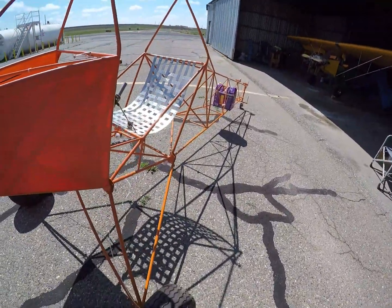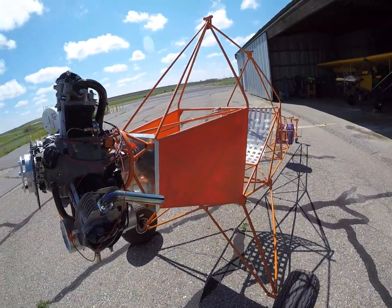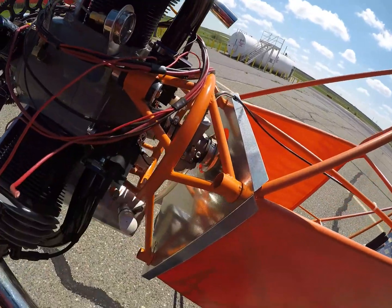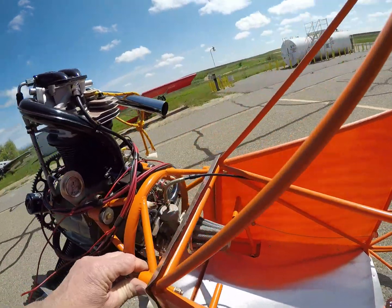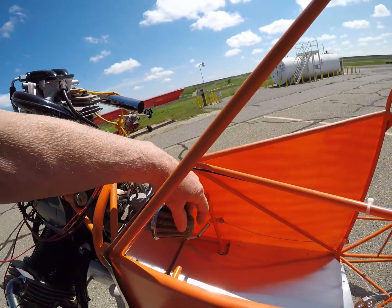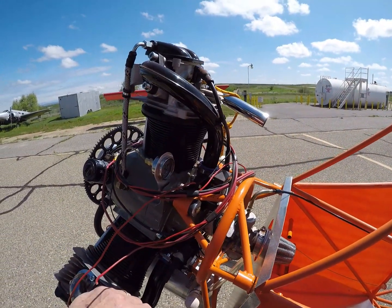You can bounce it around quite a bit on rough ground. I mounted the engine out to the side like a normal standard aircraft setup — I wanted to get the CG farther back. So I've got a hole in the firewall with my air cleaner back in there a ways, which moves the engine back a little bit.